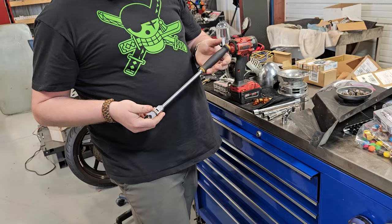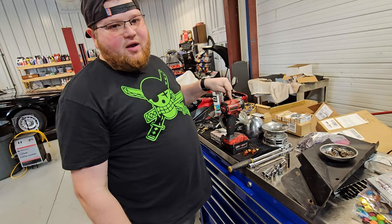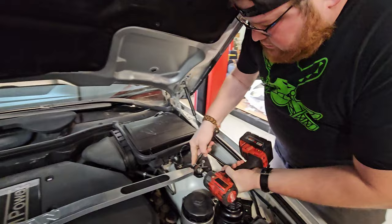The socket gets stuck. Before you drop it, you're like, I'll never see it again. Obviously, you put the spark plugs back in with a regular wrench so you can feel how much torque you're putting on it and you're not driving it home into aluminum. Starting out, what I will do is go ahead and remove the strut bar, which should be pretty easy.